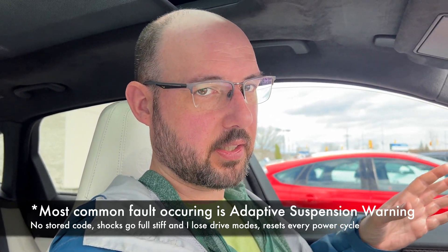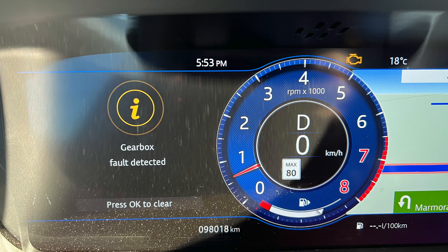That's the most minor thing that's happening. The other two things that are happening are more intermittent but more serious. I get a check engine light every now and then, and I've gotten a gearbox fault twice. I've had it where I'm just cruising in seventh gear for a long time with light throttle input on a grade, and it slips out of seventh. Those are more serious issues I need to take it into a shop to get checked out. But for now I've been driving it short term here and there, trying to figure out what else is wrong with it before I take it in.